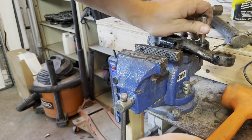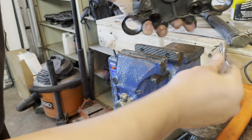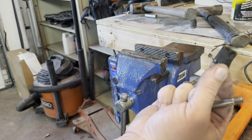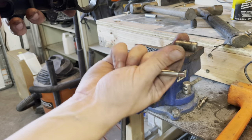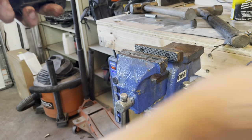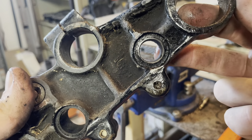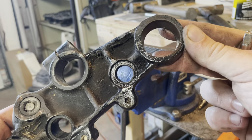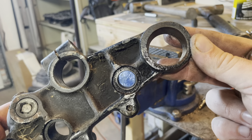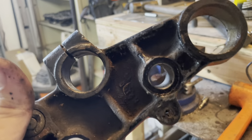That looks like a success. The bushing out looks, of course, completely destroyed. Here's the inner part that came out, and now all that you're left with is that center ring. This is really shiny so it kind of looks like rubber, but it is metal. You can see that this side does not have that metal ring, this side does — that's just the outer part of the bushing. This side also pressed out, but I think you could do it a different way, so here is my tool of choice for that.